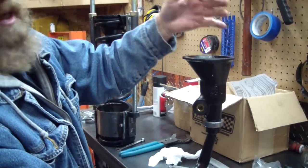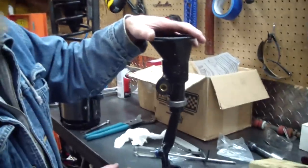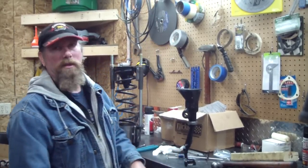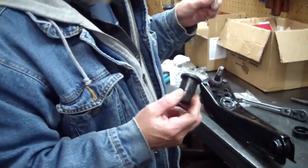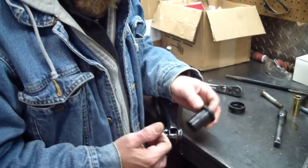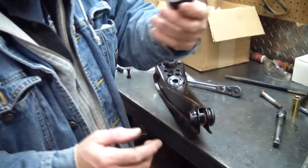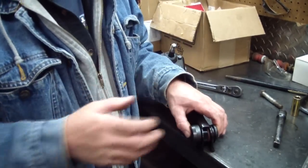So then this has to be torqued and you'll see where this whole coil will sit on top of here. You might ask why doesn't it ever pop apart — well, the shock absorber controls how much the suspension droops so this could never pop off. And that's kind of like a modern day strut but it was a long time ago. You have to be sparing with this really strong silicone grease because they never give you enough of it. This thing has to go in in one direction — there's a shoulder on this side and it has to go in from there. When that's in, this little collar will be on this side so you won't get it deflecting inside the body.